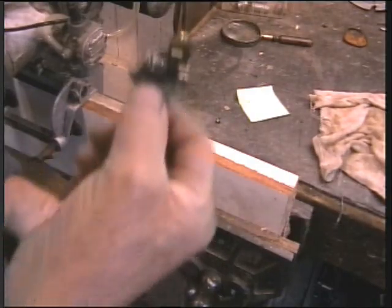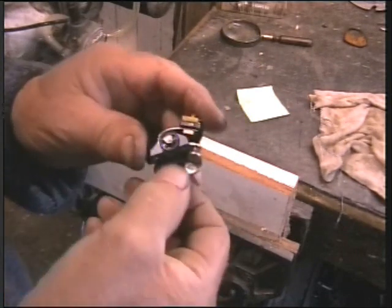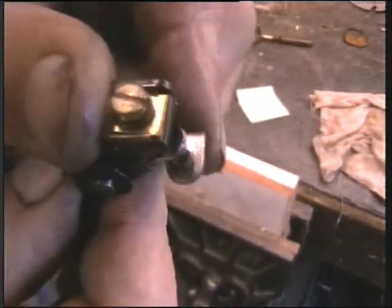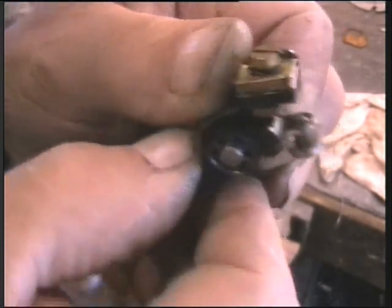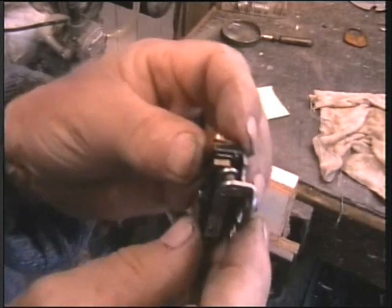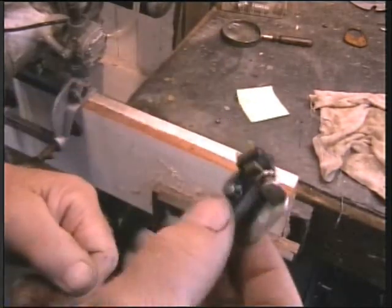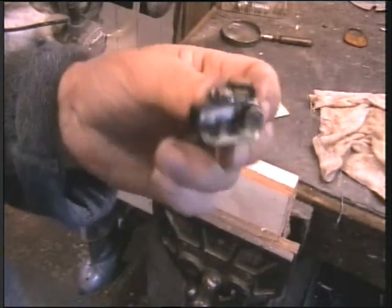Without altering the setting at all, I've lifted the points out — it's only held in by one small screw and there's an adjustment for altering the gap. I haven't touched the adjustment; I just lifted them out to take the capacitor off. I'm able to inspect the points a little bit closer. That's pitting more than I wanted — I didn't initially see that. I'm not too happy about that, so I'll very gingerly stone those until I can get two flush faces. I'm having a spare set of those — that'll be okay. Then I'll fit a new capacitor and I'll allow you 10 to 1 that'll cure our problems.